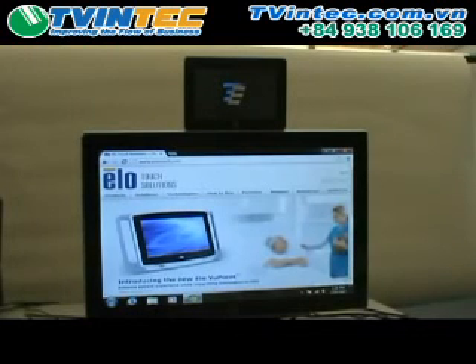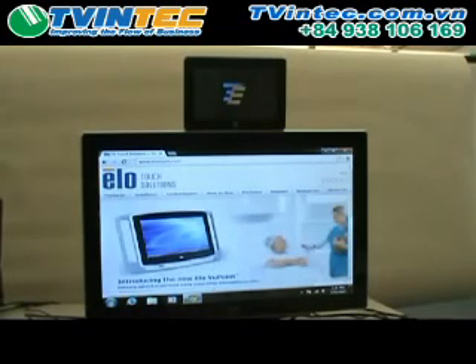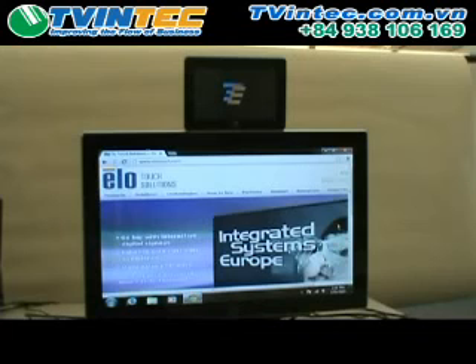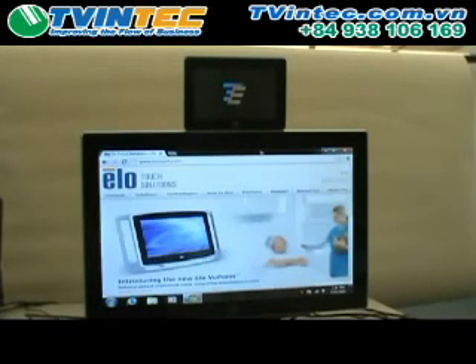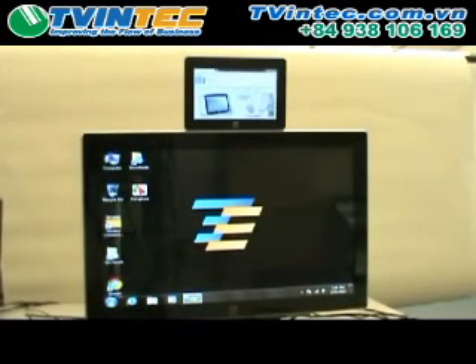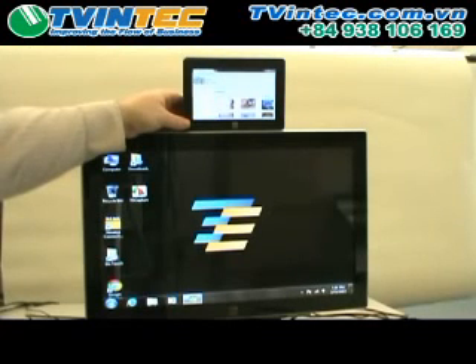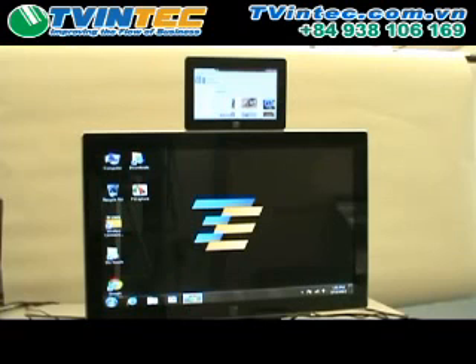We've moved the 0700L display to the top of this primary display. If you do that, you'll want to go in and do the calibration again in the ELO touchscreen properties because it will no longer be calibrated correctly. Once you calibrate it, you can do whatever you want with the 0700. For instance, you could take an internet browser, grab it with the mouse and pull it up into the display. Now you have your internet browser running only on the 0700, and it has touch — you can navigate through websites. You could have your POS application or a customer readout, whatever you'd like. Just drag any program into it and it should work.